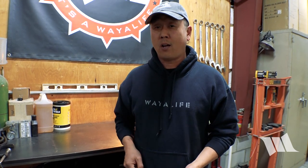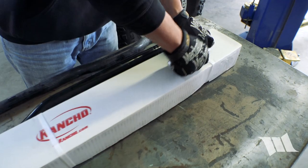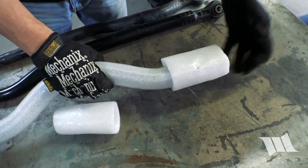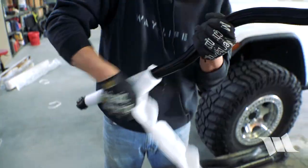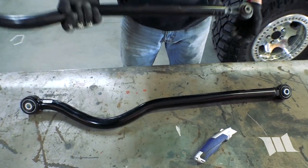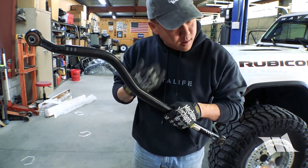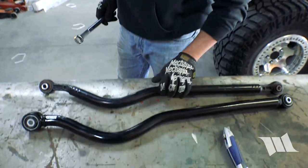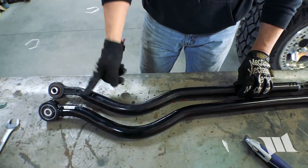The next step we're going to be doing is installing a Rancho track bar with our all-new D2 bushings, and see how that does. So this is actually a better comparison front to front. It looks beefy, but it's nothing like what the JK track bars were like — this is clearly a hollow tube, while this is a solid bar. It's about the same thickness and diameter, but this is clearly a weaker track bar. We've been having some issues, and I'm hoping that this will address them.